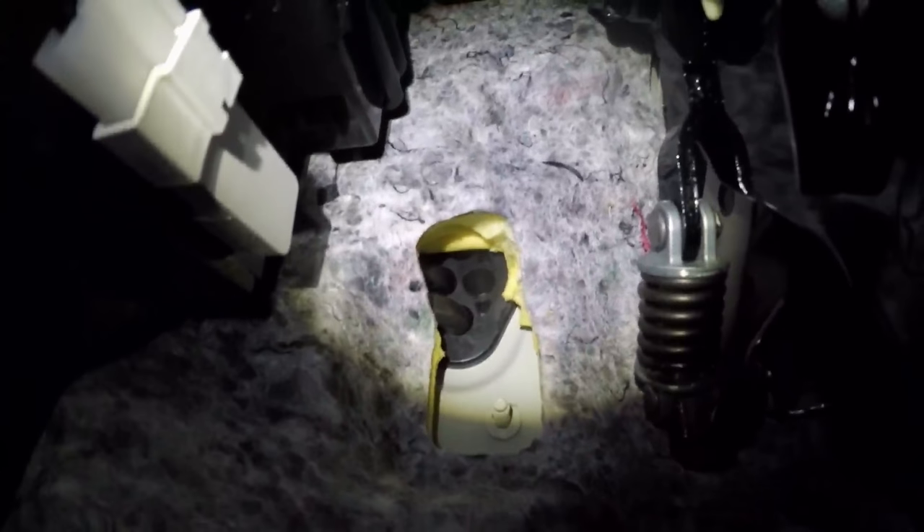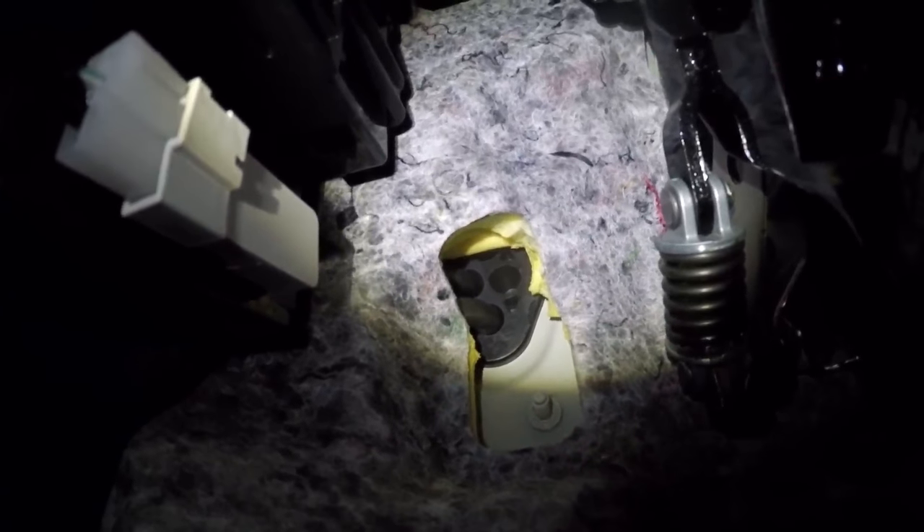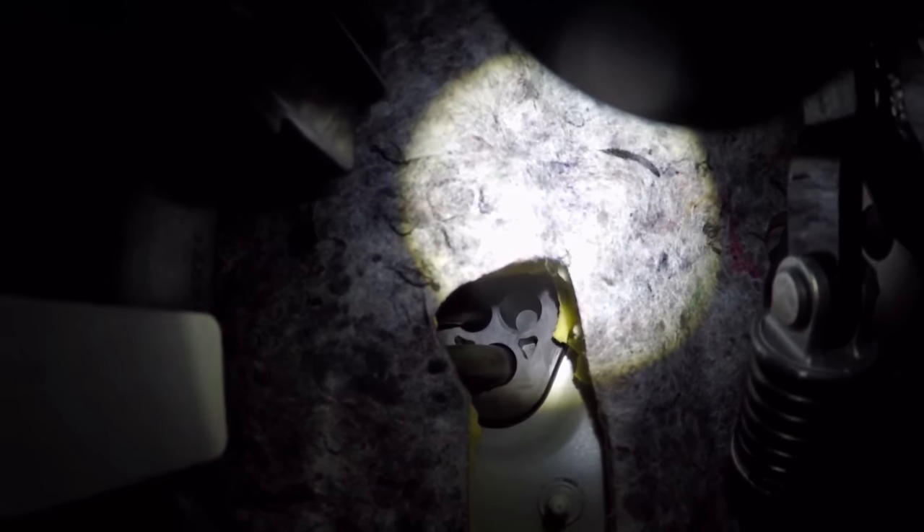I trimmed a little bit of the foam above this little square that was right there, and there we expose the two nubs I'm talking about. You could never reach from the engine compartment down into that corner, so what you do is reverse-push it — poke your hole here, push the wire through from this side into that little nub. You can then use tongs and pull it out from behind the brake booster area. That's why it has those blank nipples — for additional conduits from the engine compartment into the cabin. On GTIs they have those spare little nipples that you can slice off the top of and push wires through.